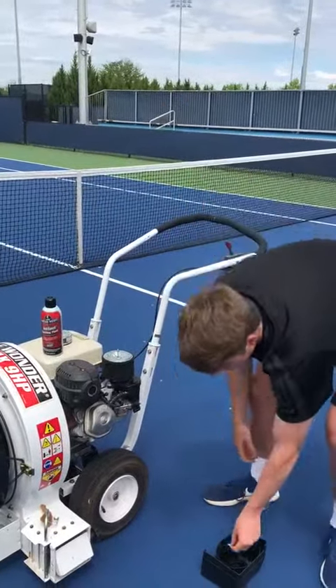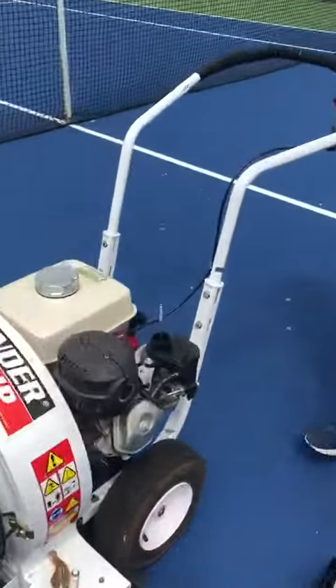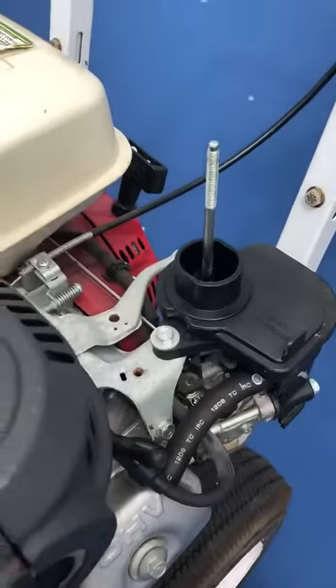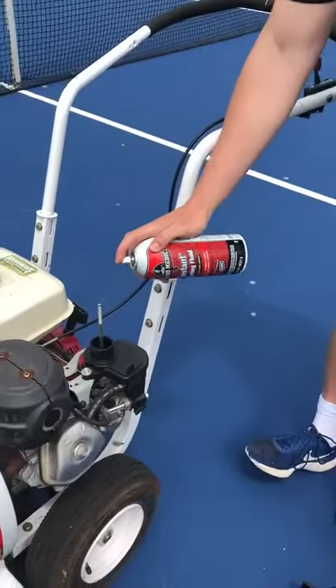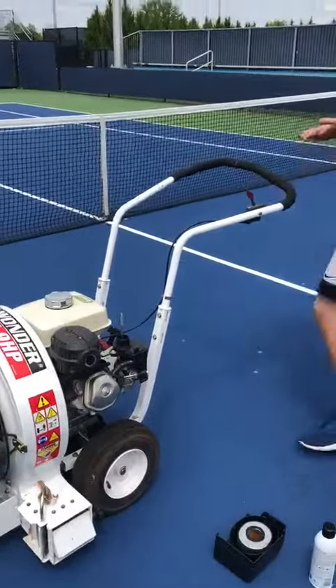Right here — put it back in the box. Wiggle out the air filter and you'll see the hole right there. You'll want to spray the starting fluid into the hole like that for about three seconds. Then you want to see if it works.